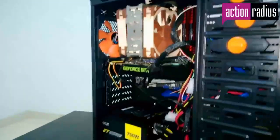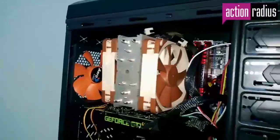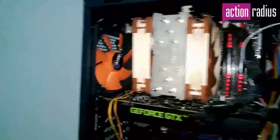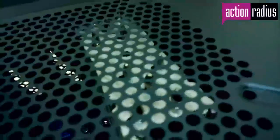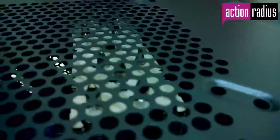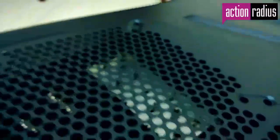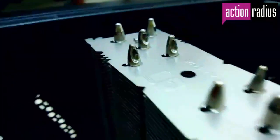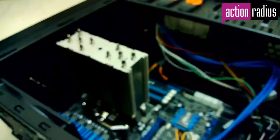Here is a look at the fan setup inside a full casing. Be careful about the two models: the 120mm model will be more universal and compatible with most standard cases, while the 140mm model may be too large and sit neck-to-neck inside a standard casing. Go for the 140mm fan model only if you have a wider casing. Always check your casing dimensions before committing to a purchase. This concludes our installation instructions.